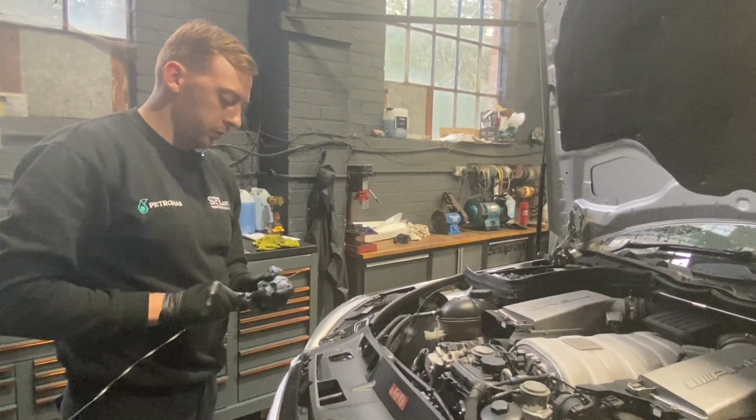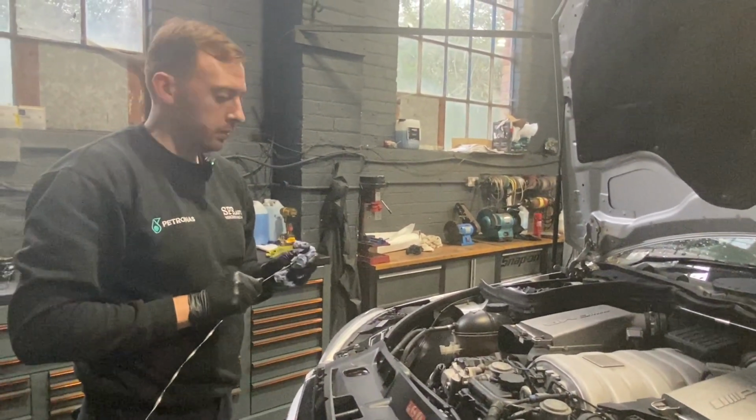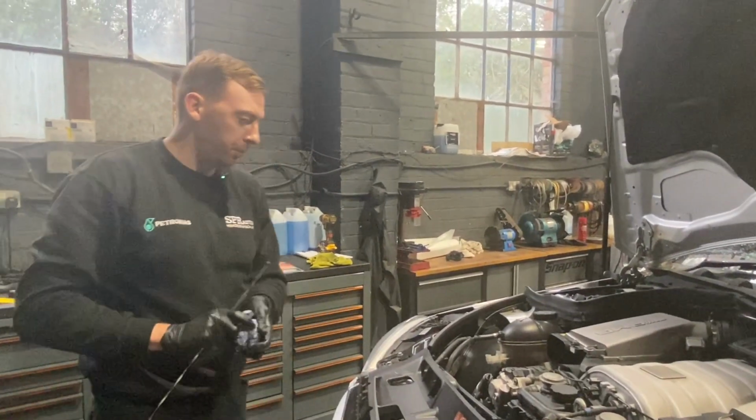And we've discovered the coolant leak problem. So I'm gonna have to pull the water pump off and see what's going on. Not sure if you can see that, but we've found the coolant leak. It's leaking from the top of the water pump. I don't know if that is a gasket issue or the pump itself. It's right at the top and I've just caught it leaking out. You can see it bubbling away in the corner there.